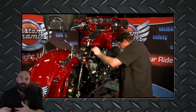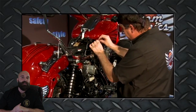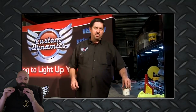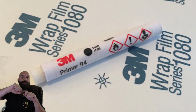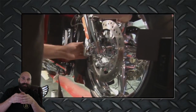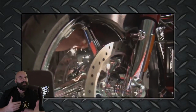I had to watch it over and over again. He also used equipment in the video that doesn't come with the packages. So he had some 3M stuff in a can instead of using the 3M primer sticks that you get in the package. With the primer sticks, you put your thumb on the black dot and break it like a glow stick and shake it up, and you get the primer at the end and you can apply it. What he had was like a small canister of it, and he used a felt pad with some tongs. It's a little bit different.